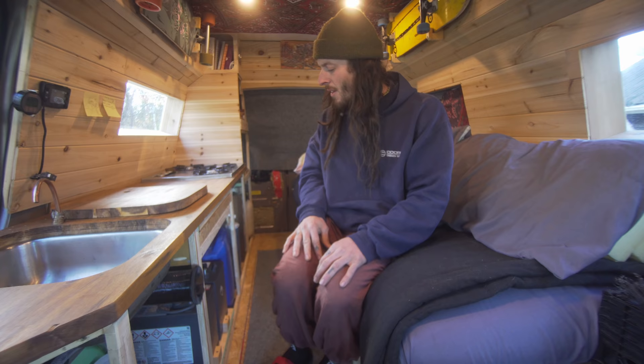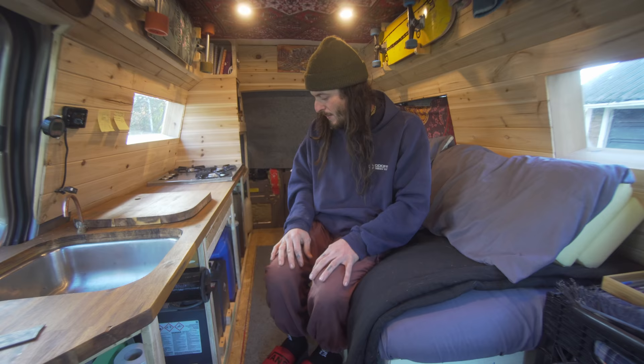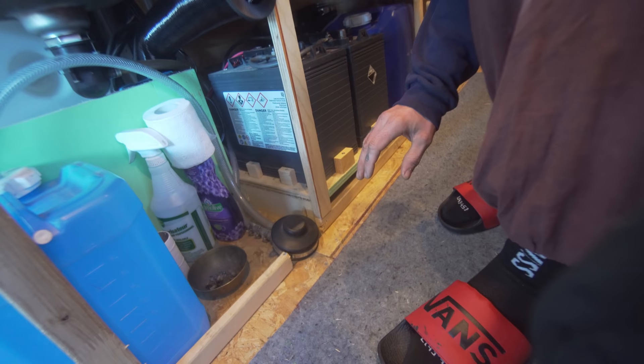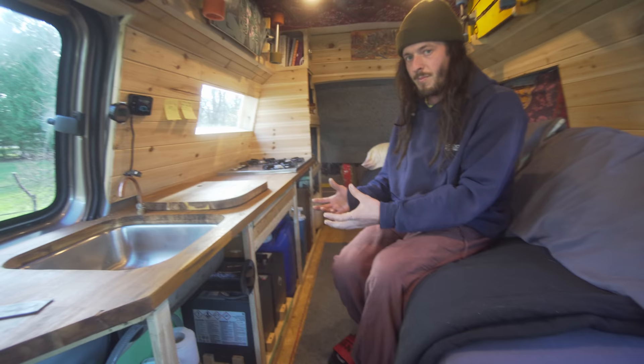For me it felt important to have the batteries stay at a decent temperature. In my previous build I didn't have space for air to flow around the batteries. But I built a vent underneath the batteries so the heater duct goes into this box, which flows air on the inside but also keeps the batteries toasty.